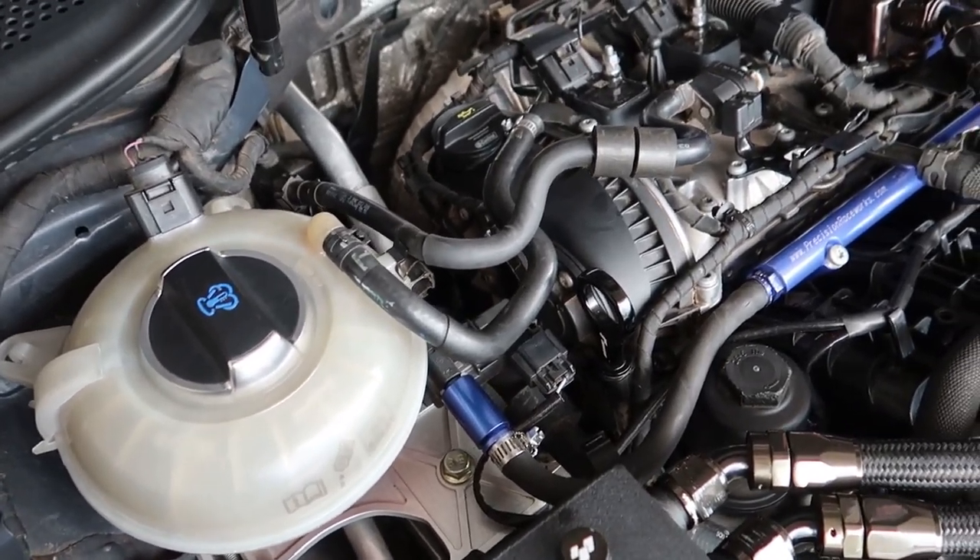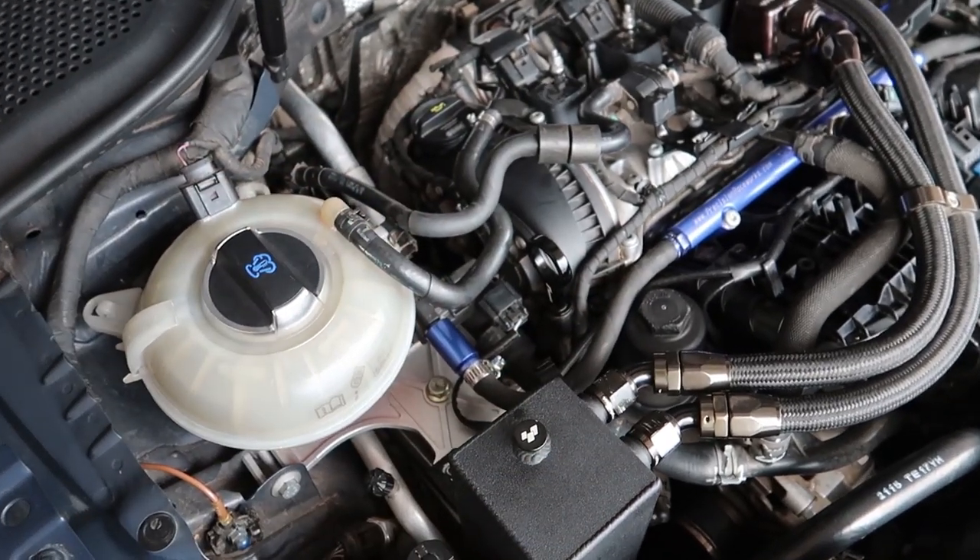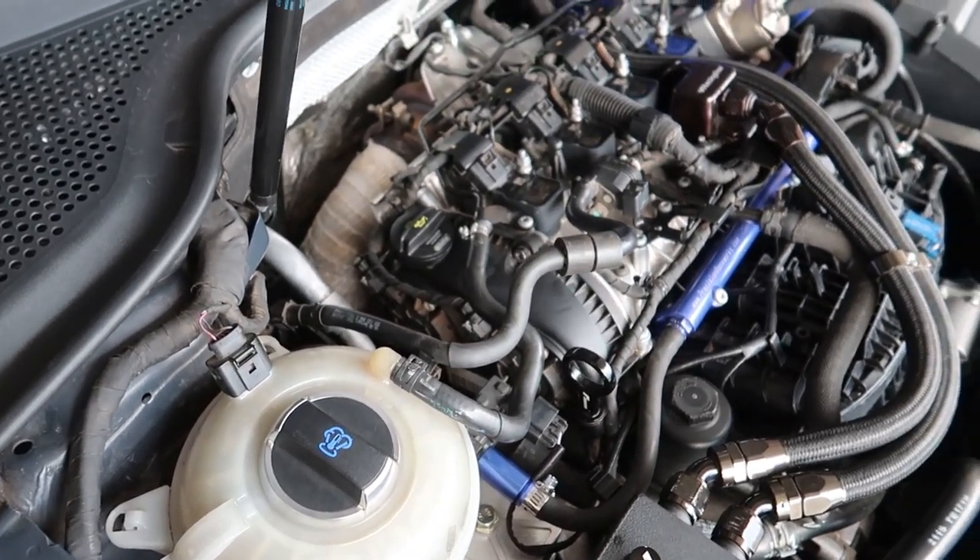With this turbo in I don't want a leak at all, so I'm going to let the car cool off and then clear out that little area and start pulling it apart. It's not that bad — there are three aluminum screws and only like five or six regular hardware pieces and then the cover pops off. Pull the seal out, clean everything off with clean surfaces. I have two cam cover seals and the one big seal for the whole cover. The hardest part is that bottom corner where it's leaking — trying to get the seal sitting on there just right.